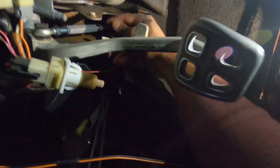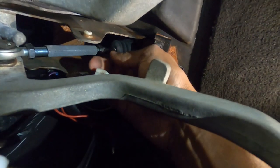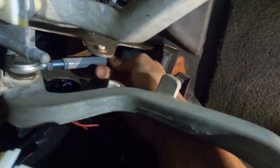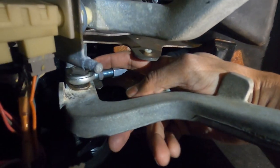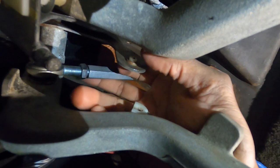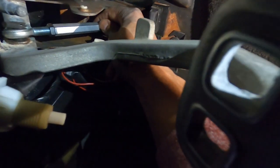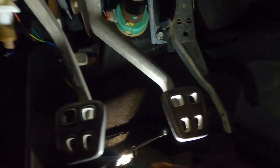I may leave it here and try that. I'm pulling this nut up here now — if you can see the nut, I'm going to tighten that nut up, and then you've got another nut here. Moving that nut and then tightening those — which they didn't do. Then we're going to throw the switch back in. You guys can see that may be a bit too far up, but it's a lot better. My brake pedal and my clutch pedal are very close now.